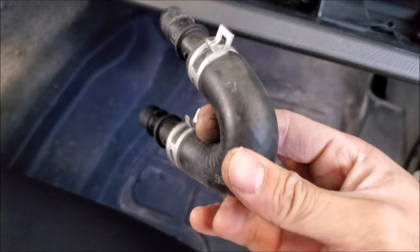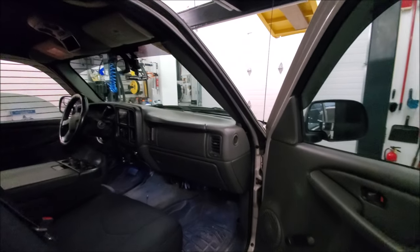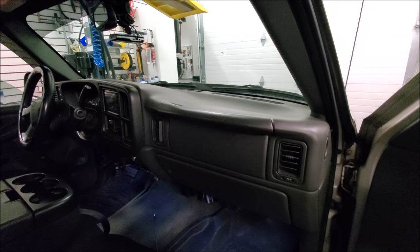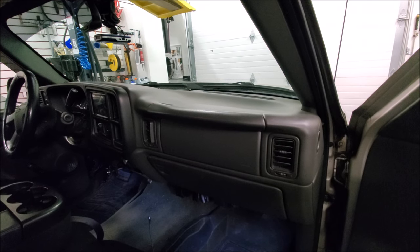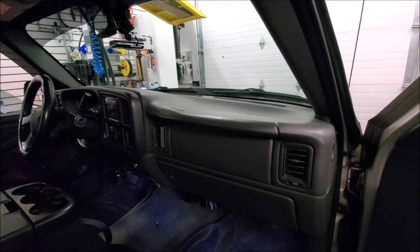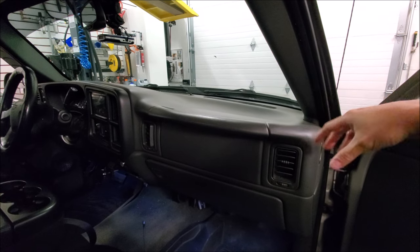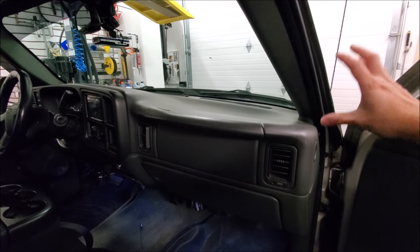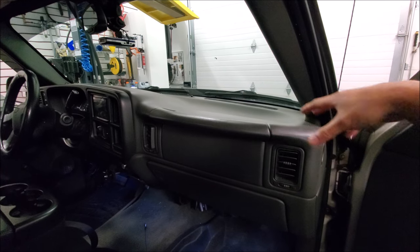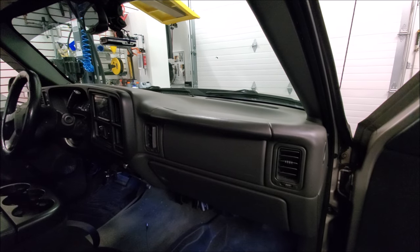The old heater core bypass — I don't recommend using it unless you actually have to, but I'm going to keep it in the glove box just in case of emergencies. Well there you have it — you can change out the heater core yourself but it is a multi-day ordeal. First get the air conditioning system's refrigerant taken out, then do your job at a time when you don't need the vehicle on the road and maybe when it's not so hot out. Do your heater core, refresh the cooling system, change out any hoses, flush it out, then hook up your heater core with new coolant after flushing so it's all clean. That way you're running all fresh coolant, then go over to the AC shop to refill it and you'll have a proper working HVAC system again.